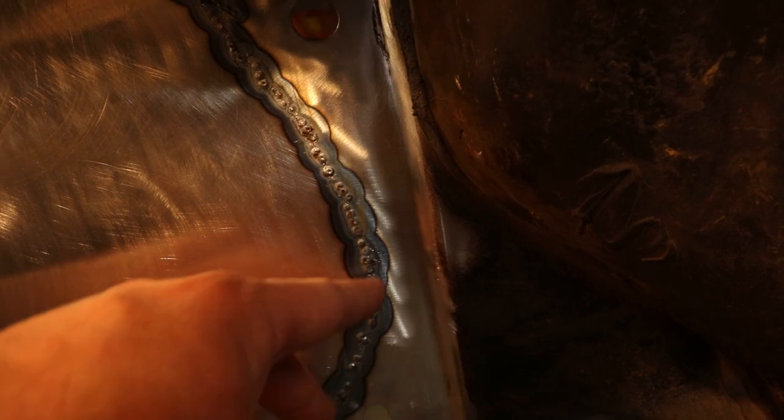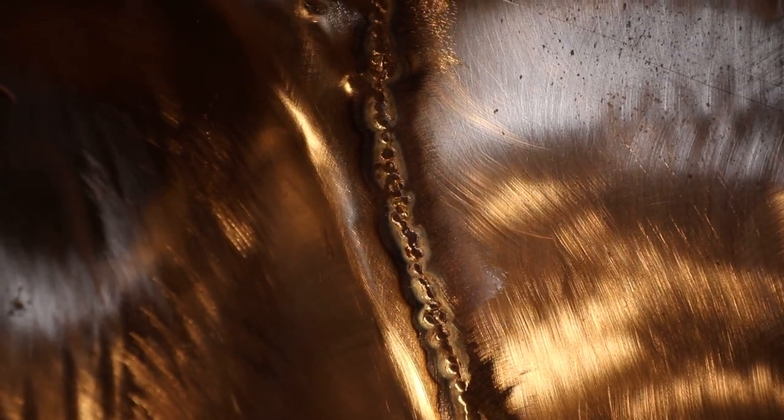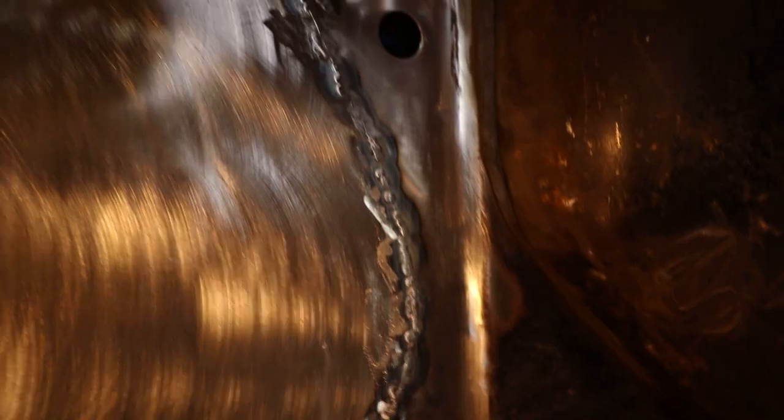I'm back — it's Saturday night about 8:30 and I've got to get something done tonight, so we're pulling an all-nighter and I'm probably gonna get about four hours of sleep. What I'm gonna do is knock down all these welds, and those are probably gonna uncover a couple more pinholes that I'll have to weld. There are little areas where the gun got away from me, so I'll have to weld all this stuff so I have full penetration. The goal for tonight is to try to clean this up. I knocked down some of these welds and honestly — F-minus on these welds, so bad. Don't you love it when your lack of practice creates way more work for you?